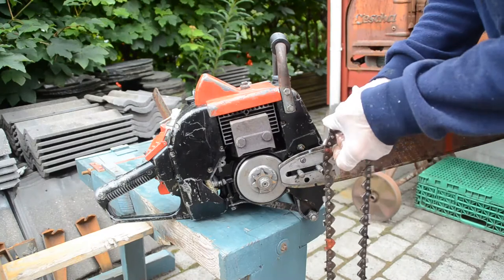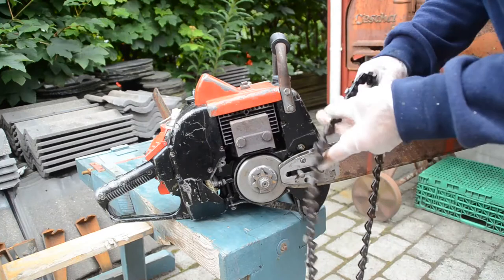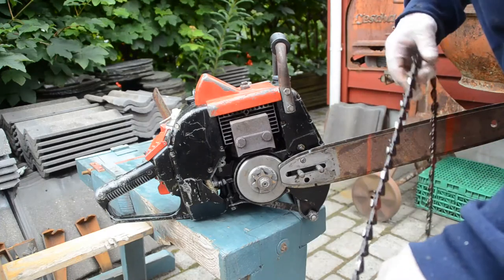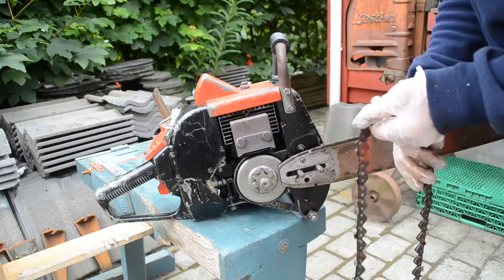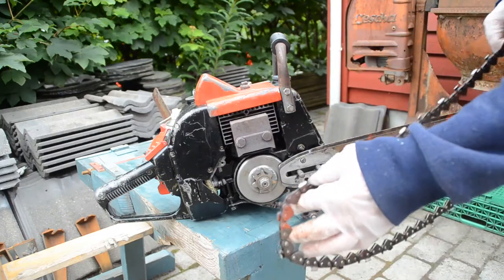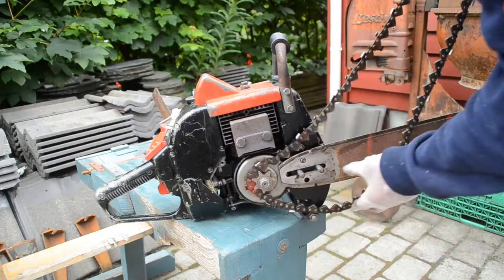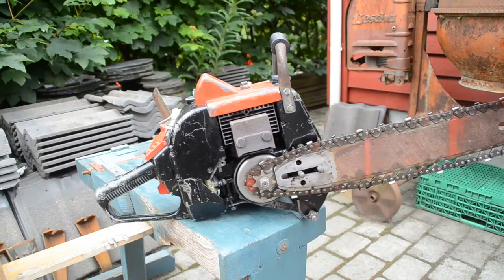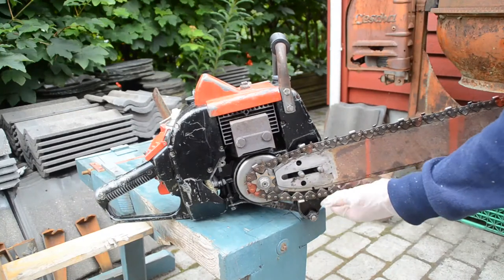This I have laid in oil for a month or two, just lay there. I did a carburetor rebuild on this. This is an ordinary Tillotson HL carburetor. I took it off and rebuilt it, with a new diaphragm and gaskets, and cleaned it in an ultrasonic cleaner. Never tried this kind of saw before in my whole life, but it's a Jobu, and it's exciting.